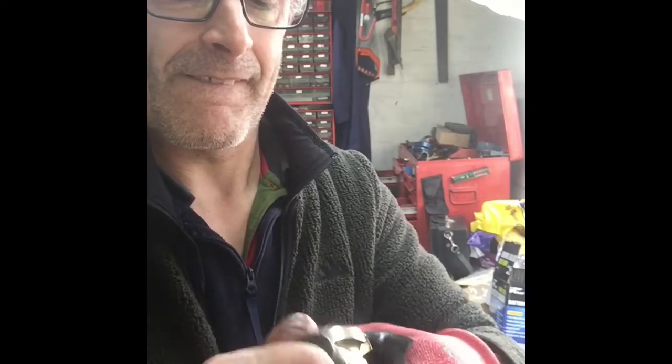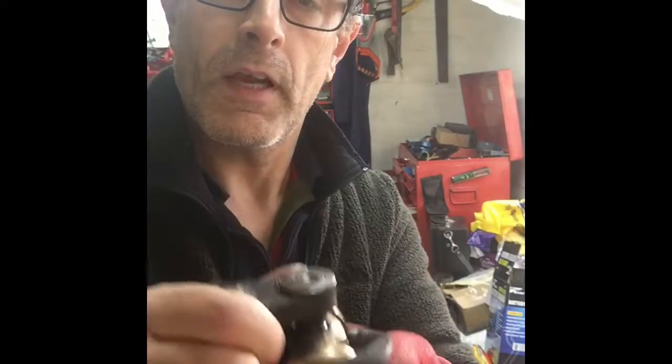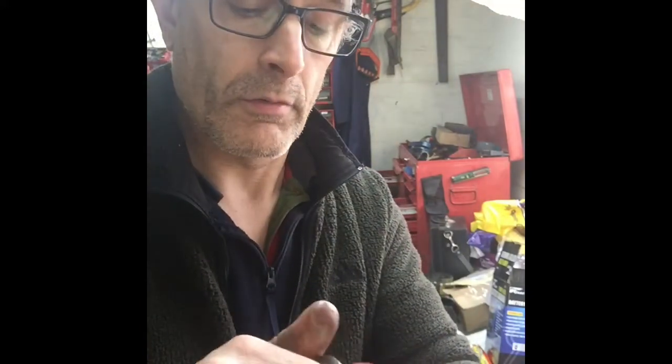It's nice and snug, but not too tight, because I was thinking as well, if it was still too much on the tight side, the last thing you want is the box jamming up on you, because if it picks up in there, it's going to force the thing at funny angles on the screw as well, so it needs to be fairly free. But we know there's no lost play, so fairly happy with that.